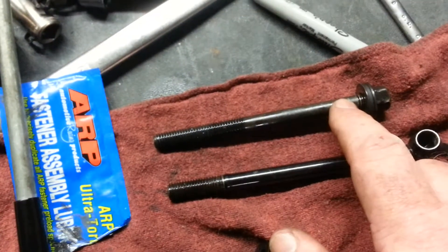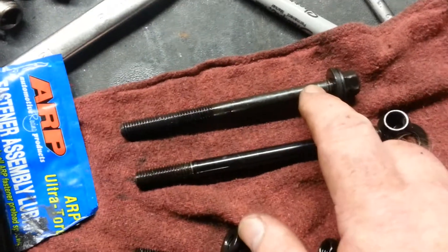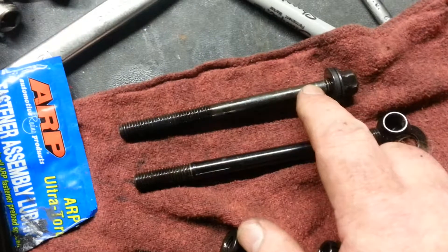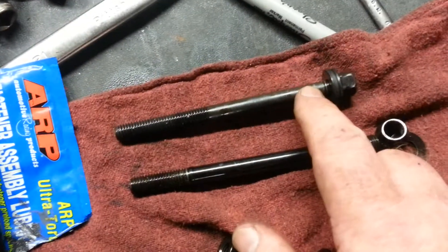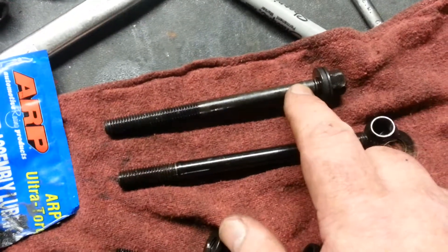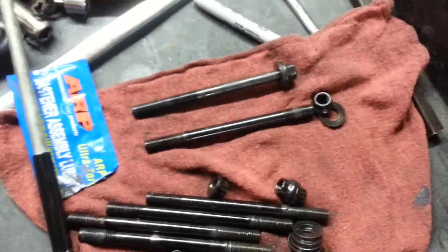In the FSM for 1995 and that year model, which is the one I have, it doesn't mention throwing them away. But if you go to buy some now — say you're doing a head gasket and you look at a head gasket set — it'll recommend head bolt replacement because they're torqued to yield. And again, it makes sense because they do have the final 45-degree turn.